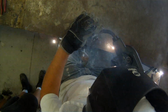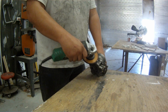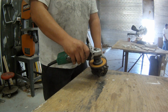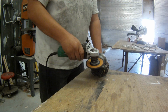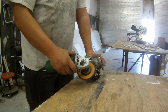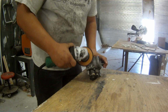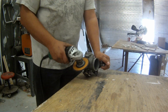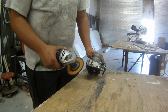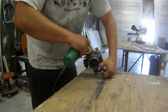I don't know if you guys use them, but I never plan on going through emissions with this car. Even if I'm living in a place that does emissions, I'm just going to put it in my mom's name in Detroit, where they're never going to do emissions, so it doesn't matter. So what I did was, the vacuum ports that go onto the top of the throttle body usually go to your different solenoids and your EGR valve, and I don't even know what some of them go to. I cut the whole set of nipples off with a bandsaw, and then I had my boss weld up the holes so that I could polish it off, and then when I paint it, you won't even know.